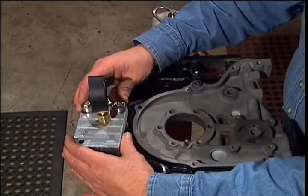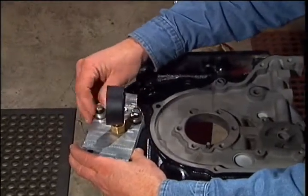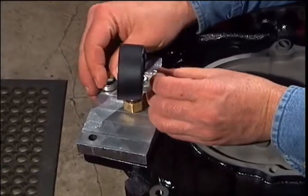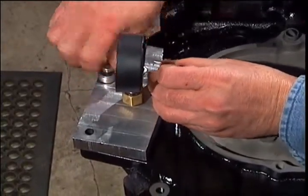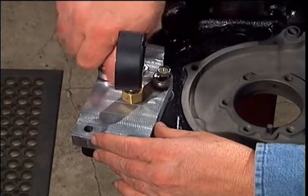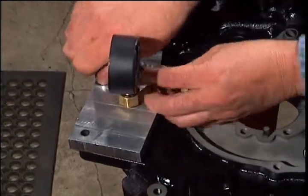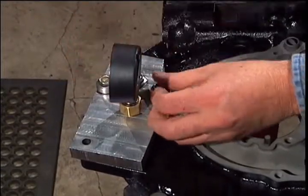At Atkins Rotary, we compression test every engine with the Mazda compression tester. We also pressurize the cooling system so that we know there are no internal coolant leaks. Starting the final assembly, we begin with installing the pressure gauge over the water pump housing opening. No need to worry if you don't have these tools handy.